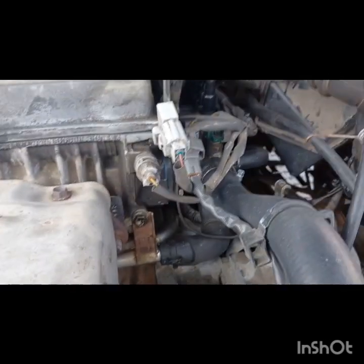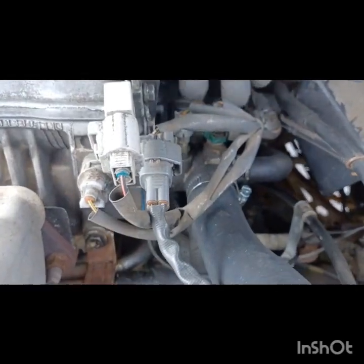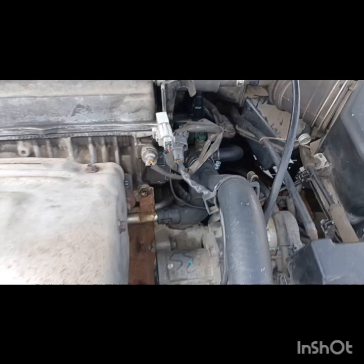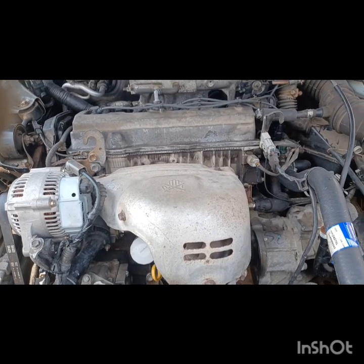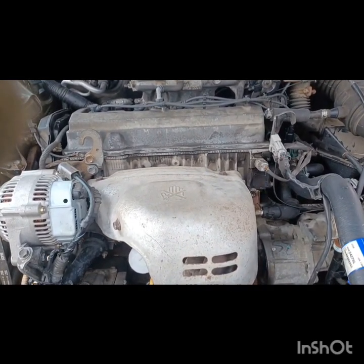Hopefully this helps some people that have issues with the system overheating right away, because there's obviously an air pocket. The temperature sensors are back here somewhere — if there's an air pocket there, it's going to read high. Like and subscribe, and I'm looking forward to seeing some other videos and talking about more than just cars.